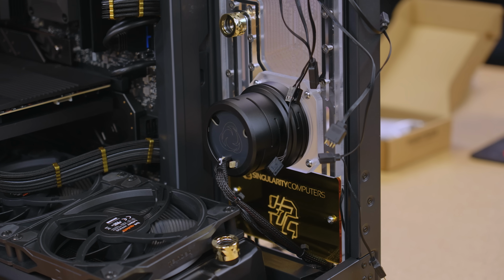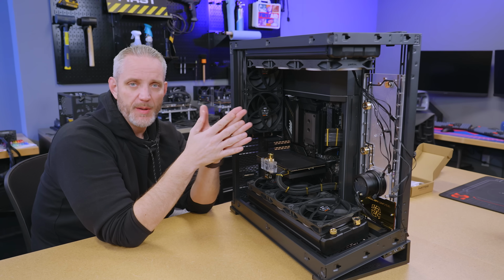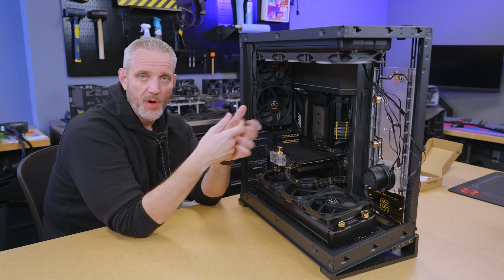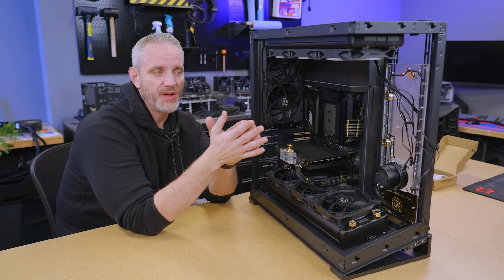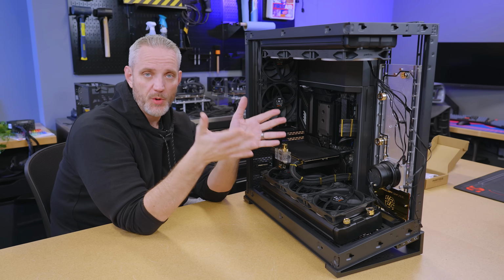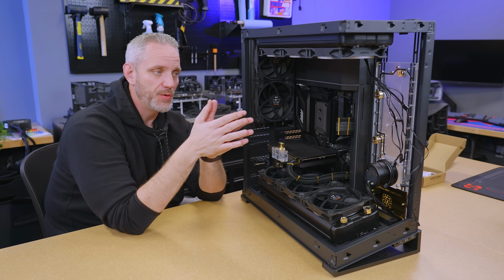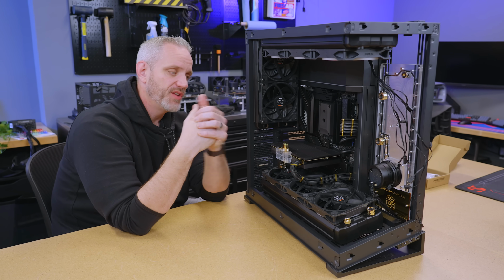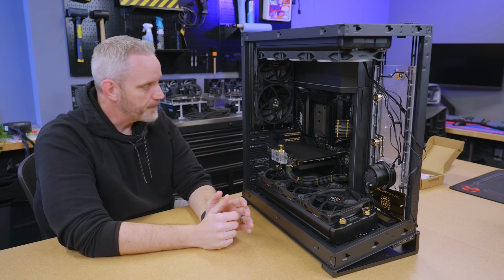They're a pain in the ass to bleed, because some pumps, if they don't sense a PWM signal, are supposed to default to 100% pump speed. That's kind of the default. Some pumps, I don't know why the logic board is different in some D5s than others, if there's no PWM, it just defaults to its lowest setting. And that is not fast enough to move air out of a system. So I like to use the manual pump wherever possible. That's just the old school part of me there.